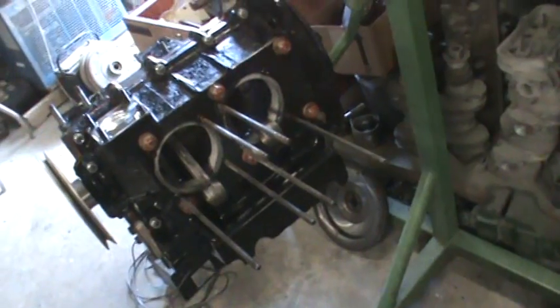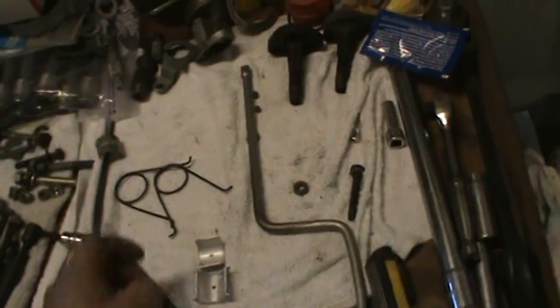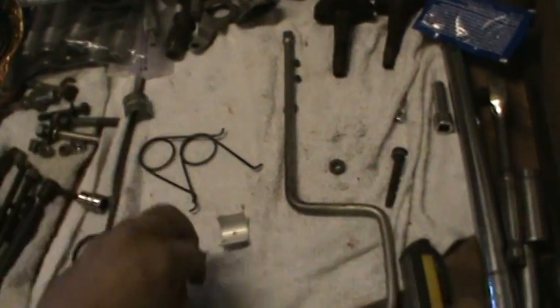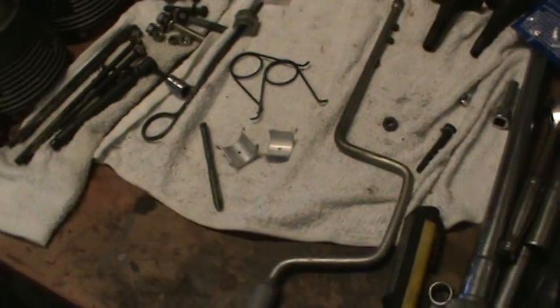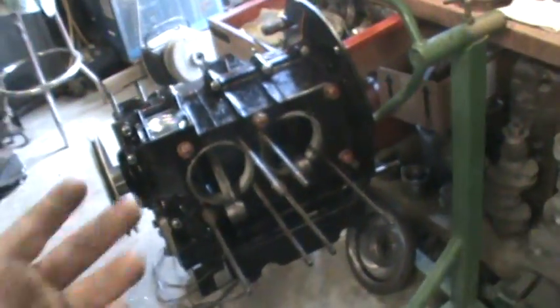You need to chuck those cam bearings. When you pull them out, they'll have tight spots — you'll see little dark spots. These were pinching right in the thrust area. The bearing's not symmetrical, not round. You can see that scuff area right at the corner of the bearing — it was pinching the cam there and the cam wasn't turning. You could start the motor and that might break in, but being that it's an aluminum bearing, it could also stick to the cam and cause havoc.